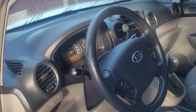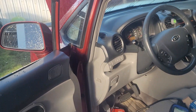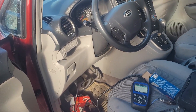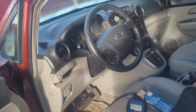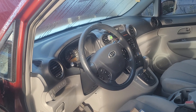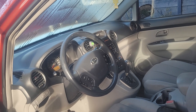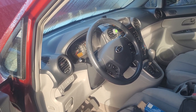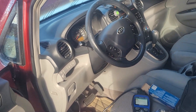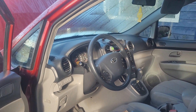Hope you enjoyed the video! Again, this is a Kia Rondo and the fault code is P2A01 — oxygen sensor bank one. Bank one is on the front of the engine. If you're facing the vehicle, it's on the side beside the radiator. Bank two is on the opposite side. Thank you so much and have a good day!